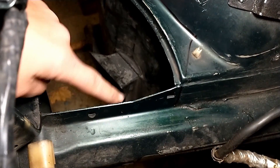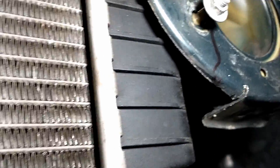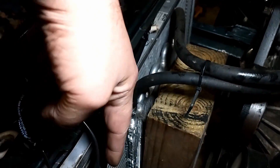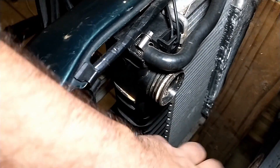I'll just chop these off front and back and then fold it over or slice it right off. Now we have the radiator mounted up here. So that was the section that was taken off and that's about how far back the radiator is going to be able to sit now — it kind of sits right in this pocket here. That was how much of the body had to be chopped for that to fit. As you can see the clearance is all good, and now it's actually almost just flush with the core support. Before it was 100% in front of the core support, sticking out a couple inches into the engine bay. So now the turbos will actually have room to sit right in front of the radiator.